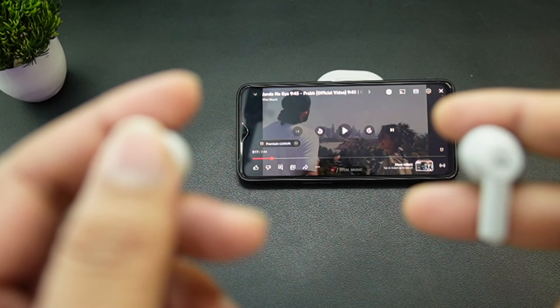You can manually power off by long press and hold. Similarly, you can power on the same way. If you don't use it, it will automatically power off. If you put it in the case, it will power off. Sometimes if you can't connect with one side, it will power off. If you don't connect both pairs, you can reset by tapping five times simultaneously on both earbuds.